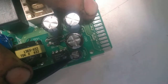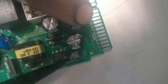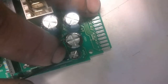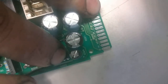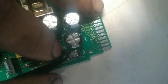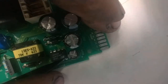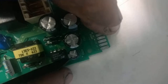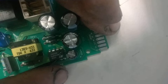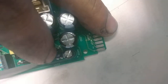Be careful when dropping your control board on a metal surface or touching it, because these are 400-volt capacitors. They get mains voltage across them, so you can get zapped. You're not going to die from a capacitor zap, but you can drop the board and damage it, which is annoying. So discharge the capacitor before doing any type of work on this control board.